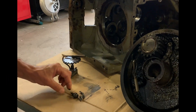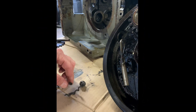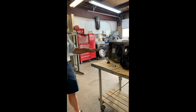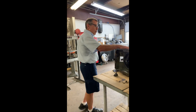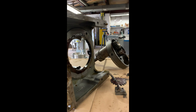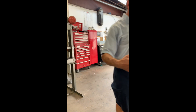That's what an oil pump is supposed to look like. These are the pieces of the oil pump that we pulled out of this machine — this machine that was in a store making dough. Someone could sell this to you and say, yeah, it works. I had to remove the gearbox to get the main shaft out of it. The planetary was seized on the shaft, so we had to remove the gearbox and press it out on an arbor press to get it out.